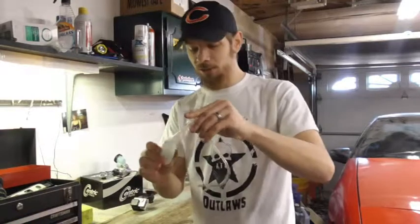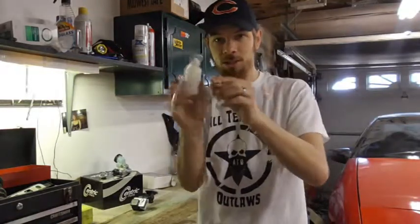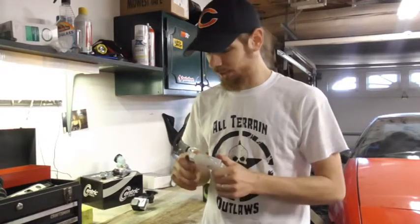However, the technique this uses is great: with the bleeder open on the caliper, this bottle is magnetized to your fender well — or I did it on the struts and some brackets — as long as it's above the caliper. Then you're slowly pushing the pedal from the driver's seat with the bleeder fully open. There's no pumping it up and then opening it; none of that. It lets the air bubbles rise up to the top and go into the bottle. The bottle is a little small though, so in some places where I flushed out fluid I had to empty it two or three times, which was kind of annoying.